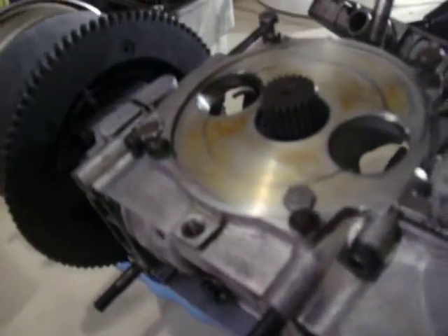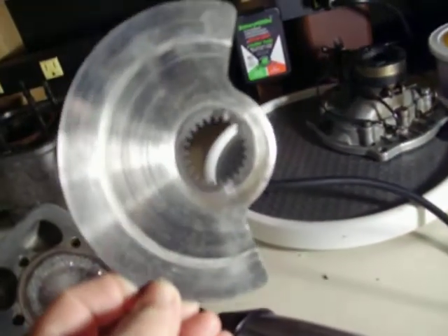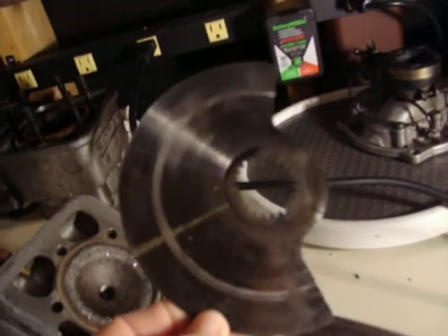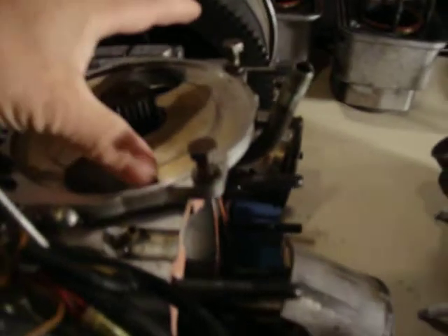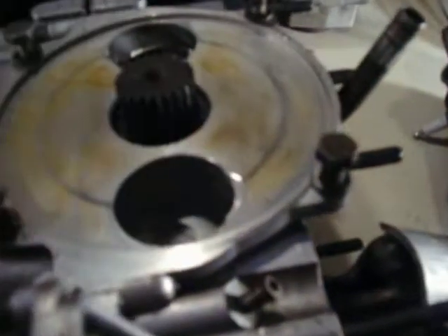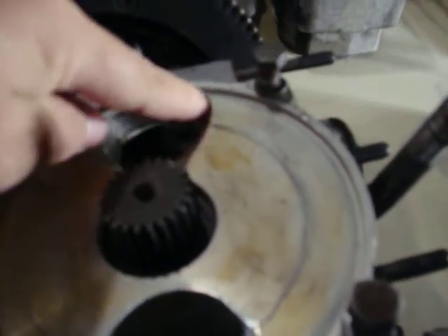Moving over to this side, we haven't opened the crankshaft yet — that's going to be new and coming to us. You'll notice there's no real scoring here, just small scratches. You can see where the pieces of metal scored the inside as well. There is also scoring around the intake valves where the metal was flying around in a circular motion for quite some time.